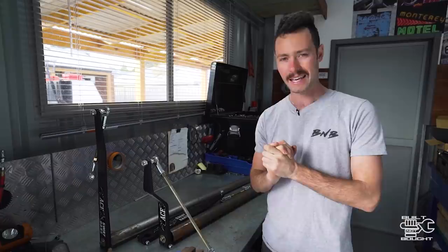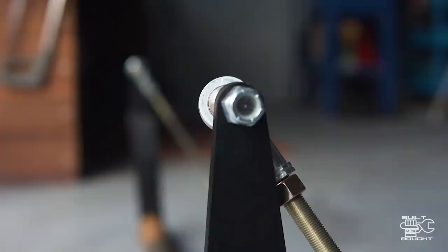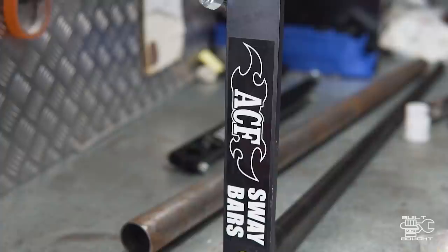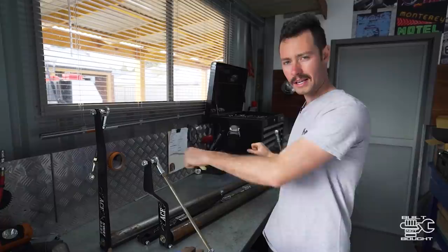The reason I didn't upgrade them earlier is because I knew I wanted to go with these. This is some awesome new technology — they are torsion bars from Aurora Custom Fabrications, or ACF. These are sort of almost like a trophy truck setup: there's a big splined axle inside a tube, and as the diff pivots or flexes, the opposing torsion on each side causes tension to bring it back to center.